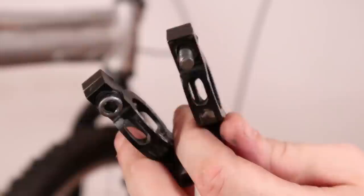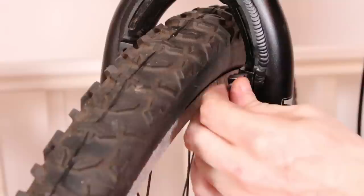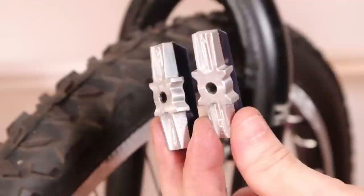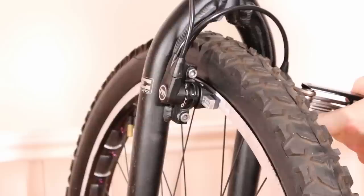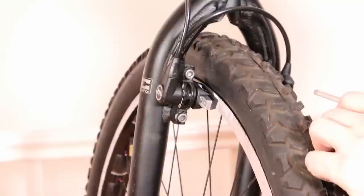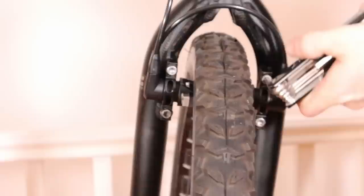I'm going to see what the fuss is about and fit a matching front HS33. Some Echo clamps will do the job of clamping. These forks take bigger M6 bolts which is actually a great idea — bigger bolts are stronger and stiffer and less likely to strip. And these were a good find: brand new T&N pads, well liked in the trials world, although I do think mine are better. The CNC backings are definitely brilliant though. The clamps are designed not to use the usual cylinder washer to align the caliper — instead they clamp directly to the cylinder for extra stiffness. The disadvantage is that if the frame or fork mounts aren't straight then your pads won't hit flush, but they'll soon wear flat.